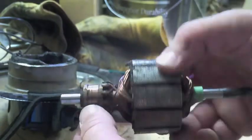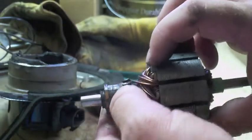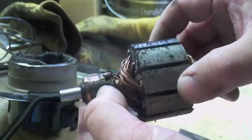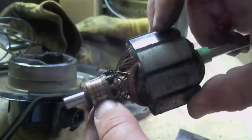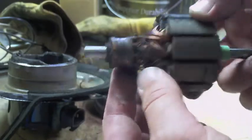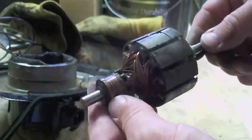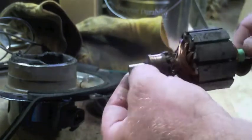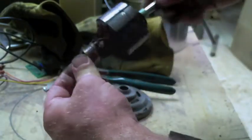So I really can't explain it. There's no sign it's extra dirty inside, but something just ate this motor alive. You can see there's probably the dead spot right there — when she'd stop on those it wouldn't start on its own. It's still turning though. Like I said, if you whacked on it she'd start up and seemed to run normally after that — low, medium, high. There's no scoring on the bearing surfaces, and the self-centering wobble bearings are fine — even dry, no slop of any kind.